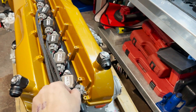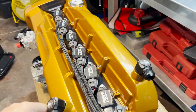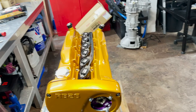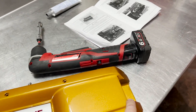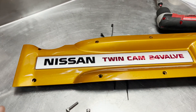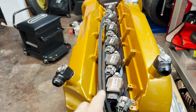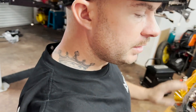Personally on my behalf I probably should have done a little bit more reading and investigating - you can't run a valley cover with the HKS coil pack kit. I think they like to have it off to let heat out, and normally if you see HKS high response motors they have those nice little red bungs in all these holes and it looks pretty good. From the front it looks really good, but it also looks like something's missing. So I'm going to modify this valley cover further.